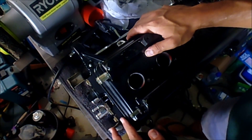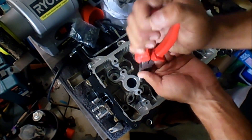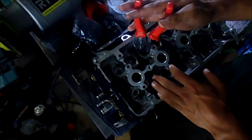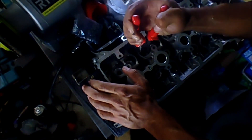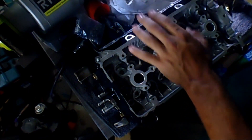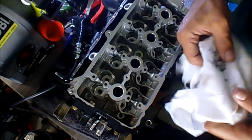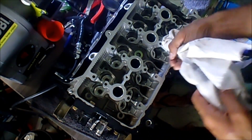That was an attempt to keep everything black. I'll just take one out here — I'm going to be using a grabbing and twisting motion as I pull up, with a little bit of maneuvering from left to right and front to back. I'm going to squeeze it tight, twist as I pull up, and try to pull up straight so you don't scratch the inside of where that lifter goes. And that's it.